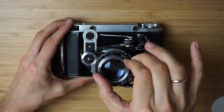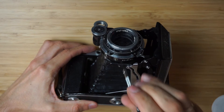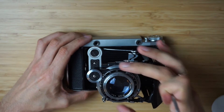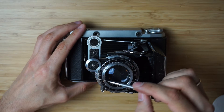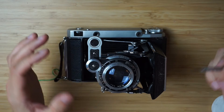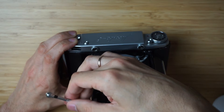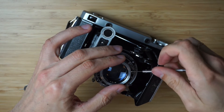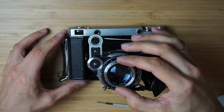To do so I first need to remove this stop ring, and this is really easy to do. There are three small screws here. By the way, it's better to remove this ring when the lens is in infinity mode — so this is infinity and this is the focusing mark. It's not a problem if you remove the stop ring in any other position, but if you don't want to fix anything extra, it's better to start from the infinity position. You don't actually need to remove those screws — you just need to loosen them a little bit, and then you remove the stop ring.